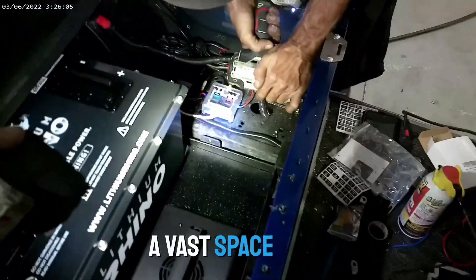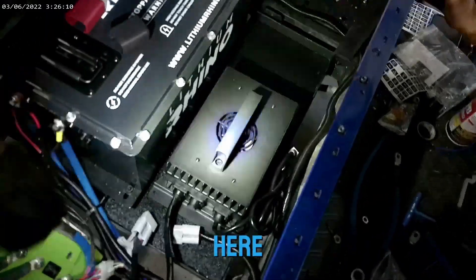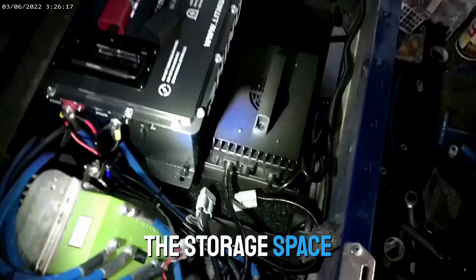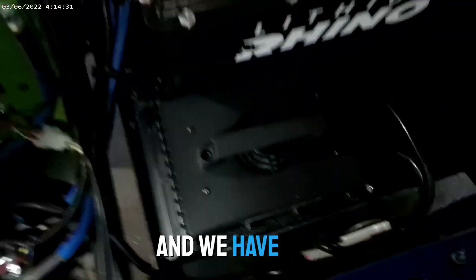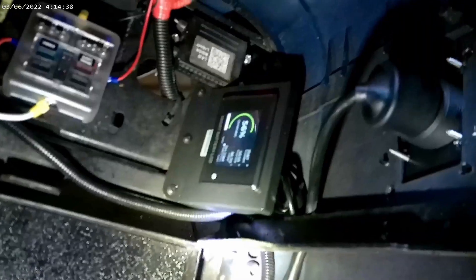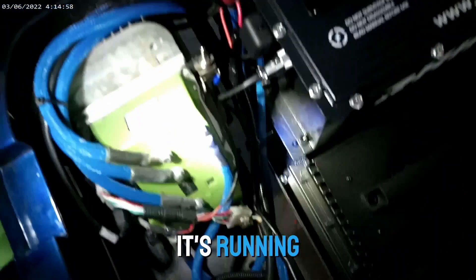Normally, if you don't have all that stuff over there, we would mount the charger over there and then this would all be storage space in the middle. But we're kind of out of room in this cart, so the charger's going to have to take up some of the storage space. So we've got the Lithium Rhino 51.2-volt 105, with the charger mounted on board. That's your state of charge. We've got the converter and the fuse block — the converter is right off the key switch, so when you turn the key switch off, your radio and everything shuts off. Everything's wired up and it's running. Looking good.